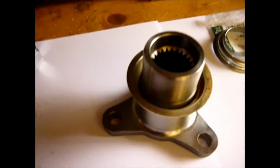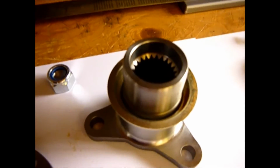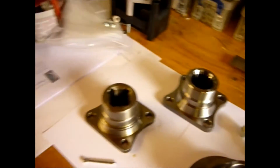The last of the units, if you're daft enough to run one on your vehicle, because it's a much better idea to change it across to one of those and put a different spacer on the prop. This is the 3-bolt with the nasty donut, again 24 spline, again with the nasty Land Rover tin thing on it, and this is part number STC 3723. Now these all have different seals.